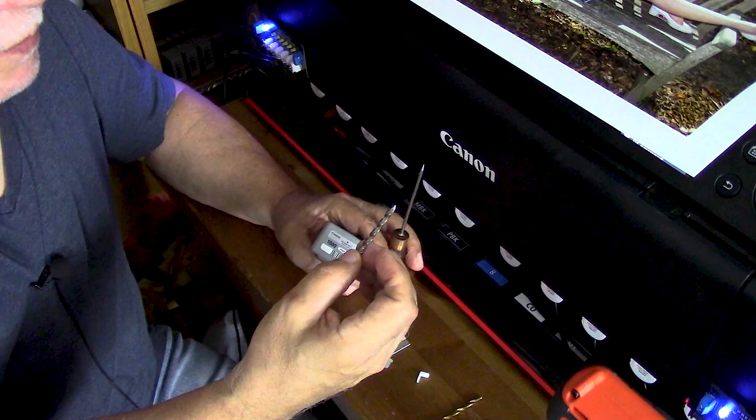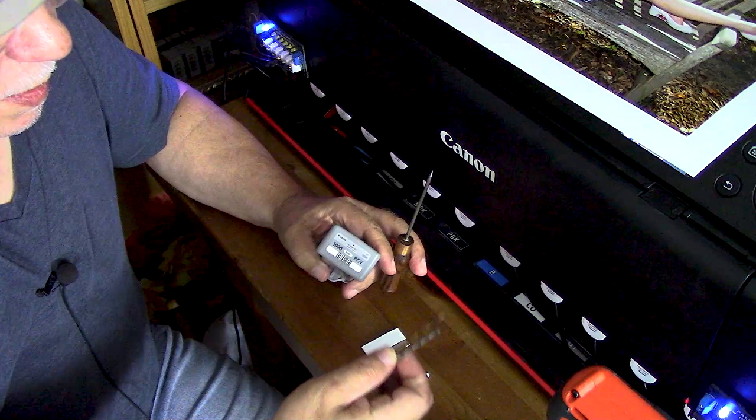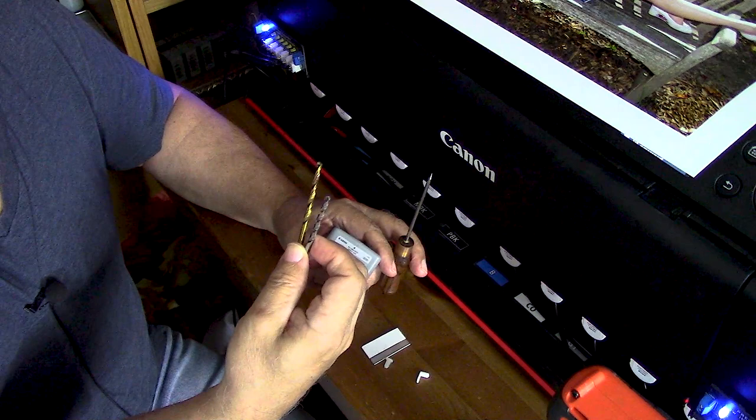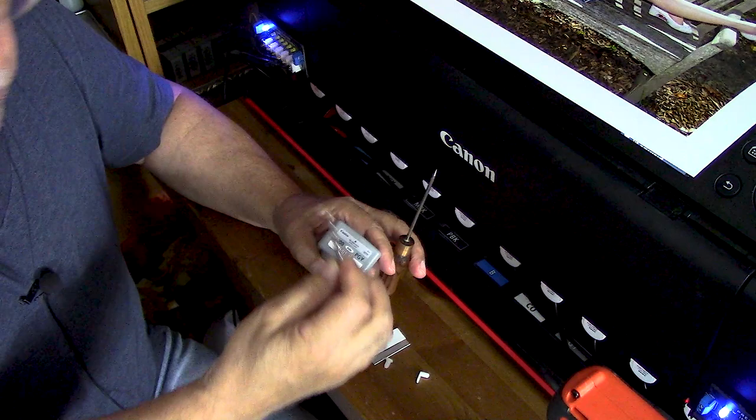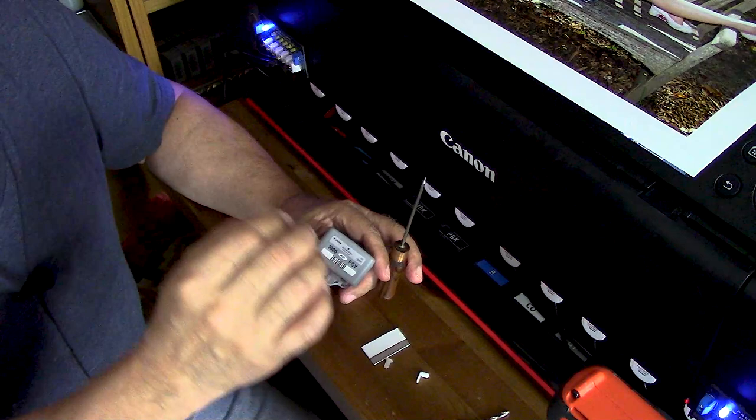I'm going to start off with a smaller drill bit, and I have that already mounted on my drill. The golden looking drill on the left is for metal, and the cutting edges are actually very low angle, and they do not do a good job on plastic. So I am using my plastic drilling bit, which has a more acute cutting edge to it. That will give us a cleaner hole, a cleaner result, and a much more accurate round hole